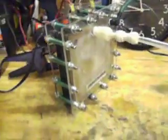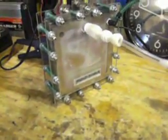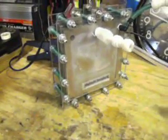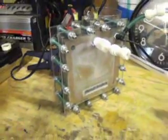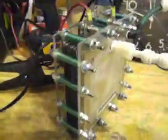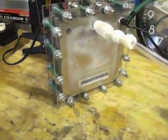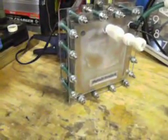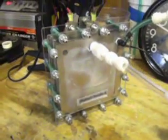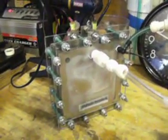As I've explained in my other video, I have seven cells per side on this center tap design, which means each cell sees about two volts. The minimum voltage for electrolysis is about 1.24 volts, but with brute force it's very hard to start and maintain that reaction, so two volts is your target. If you've got a design with only three or four neutrals, you're talking three to four volts per cell, meaning over two volts per cell is being wasted in heat generation.